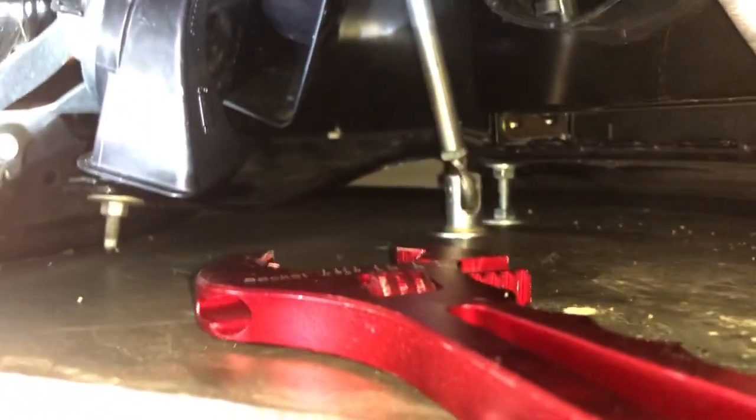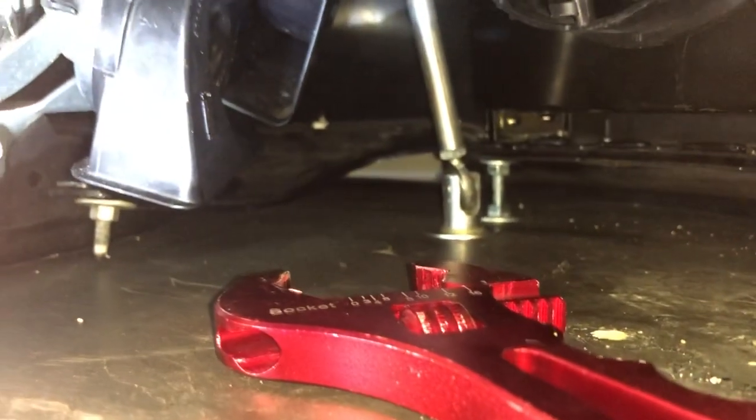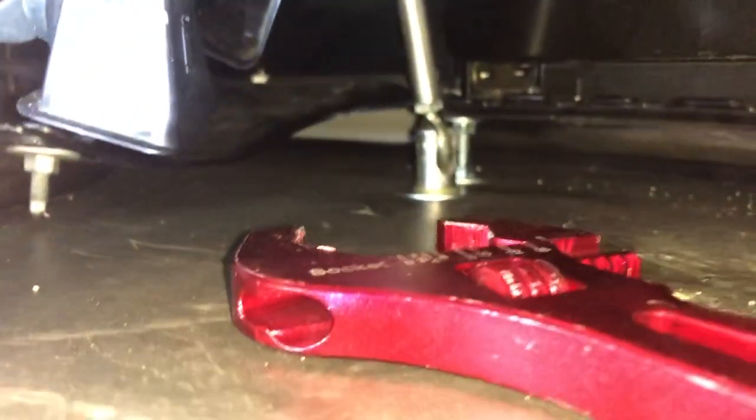And then with the screen on it, I don't know if you can see this or not, but you can kind of see the screen right there. It's wedged up as far as it can be in that other corner, right up against the bumper, and there's a little bit of air gap right here. Also, if you look underneath, you can see the opening for the front on the stock splitter comes in. Some air comes under there as well that gets a little circulation. So I've got pretty good circulation back here. I think I've got enough airflow even with the small front bumper opening.